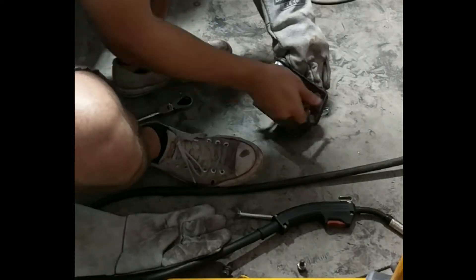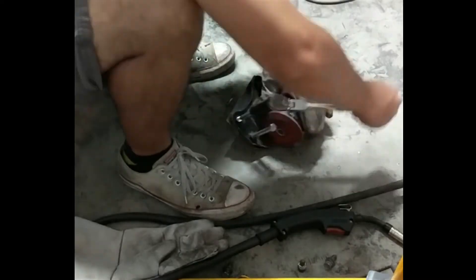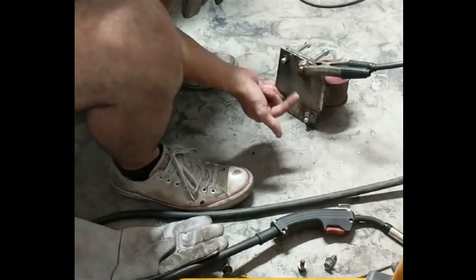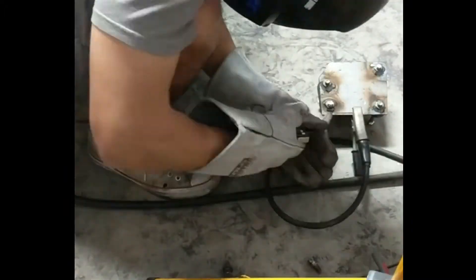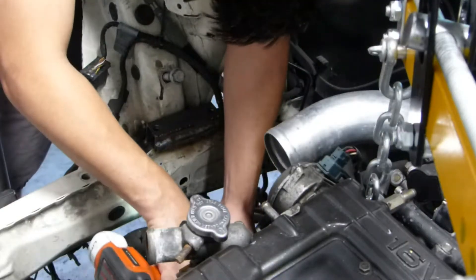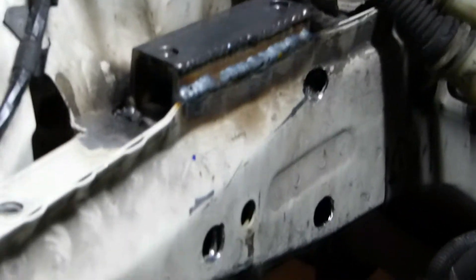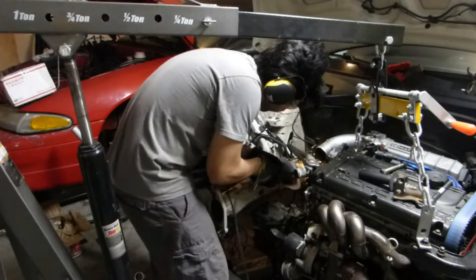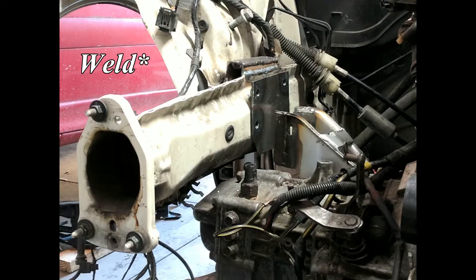We're working on the transmission mount side, tightening up nuts with bolts going through to lock the plate that's going to be welded to our frame. We have perfect bolt lineup with the OEM mounts, so we'll weld those nuts into the plate and fully weld them to make sure they don't break — because if those break, they're stuck in the frame. Drilling out the frame is actually pretty tough; there are a few layers of relatively thick steel there. Then we have to grind off all the paint and make sure our plate fits perfectly in those holes, grinding away a bit of the extra nuts.